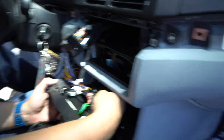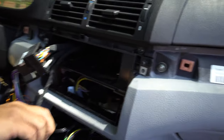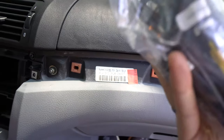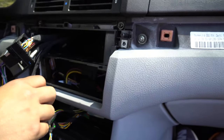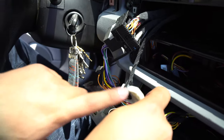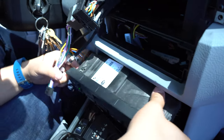We're going to test fitment next — make sure the head unit fits right down there. Then we can try all the accessories like Wi-Fi and extra USBs. He can put USBs in the glove box to charge his phone — there are three USBs. Another popular thing is running a dash cam from here powered through USB, so you can have a dash cam, charge two phones, or use a flash drive to watch movies, and you also have that micro SD card. When installing the cable, make sure the tab is in the open position because this will hold it and help you slide the socket in — otherwise it's not going to sit. Look at BMW with the over-engineering: a little locking mechanism.